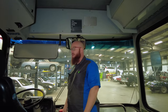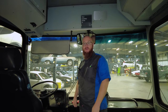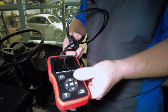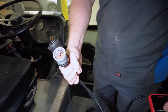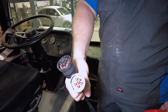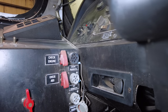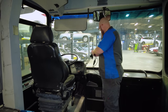In this whole process, I've been in contact with several fans and people experienced with these buses — one has been very, very helpful. One thing I've already purchased is actually a scan tool for a bus. It looks like a typical small code reader, but this is not typical — it has an OBD2 connector but this is for heavy duty applications like semi trucks and buses. It plugs in over here and gives you engine diagnostic, ABS diagnostic, and transmission diagnostic. So everything is there to read codes and data, and if we have any codes pop up while driving, I can clear them or see what it is. That'll save a lot of diagnostic time.